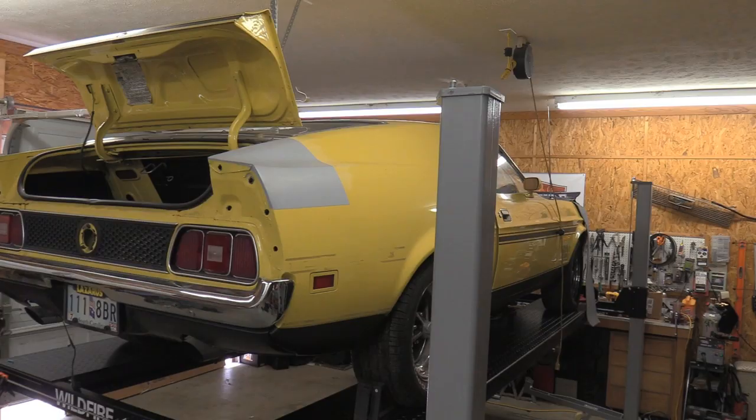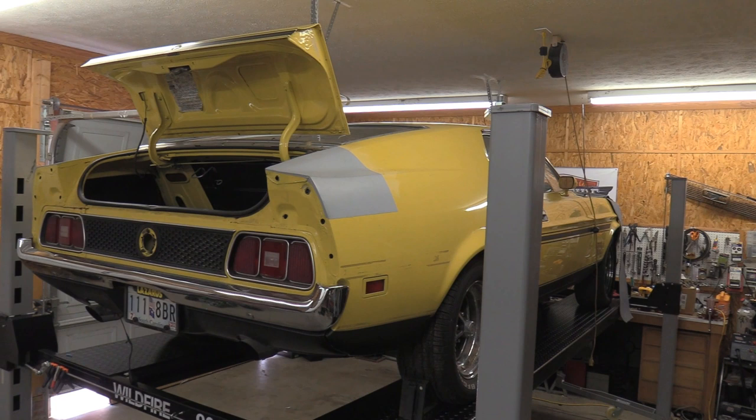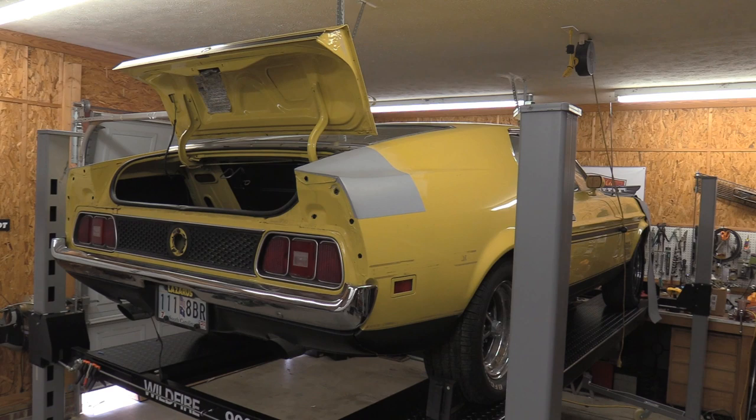From your point of view when working on the car, the LEDs give you nicely angled lighting so you can see what you're doing. Also, an important safety tip: you'll need a little bit of room above your stop position on the lift to pick the car up, get it off the safety catches, and then drop the car back down. You'll need probably five to six inches so that when you're picking the vehicle up you can open those safety catches. Make sure you've got about six to eight inches of wiggle room above the vehicle so you're not running into the roof and damaging your ceiling and the car.